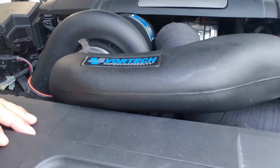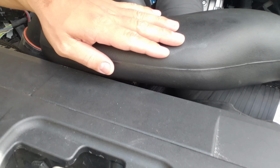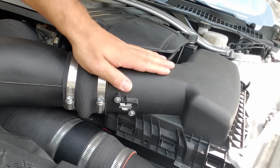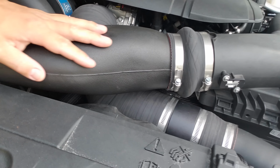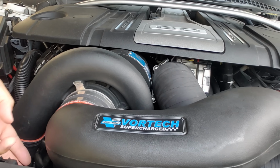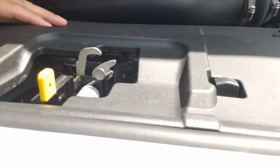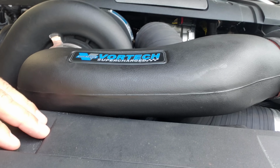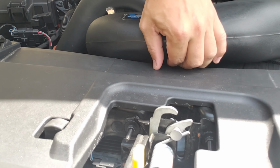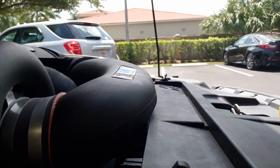The first thing I think might cause false knock on this setup is the cold air, or the charge system. It basically uses a stock air box, and it has a specially designed plastic inlet that prevents you from sucking in a bird, a cat, or anything like that. But I started noticing how close it is to this fan shroud. I'm not saying this is the cause. I'm going to do a process of elimination and start eliminating certain things that I think might be an issue.